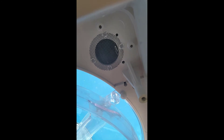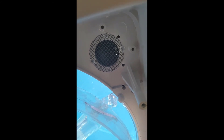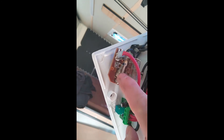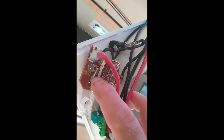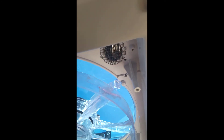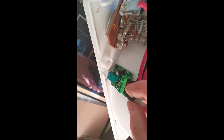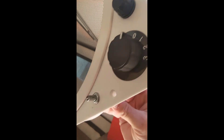I did take the time to cover that so no water gets down in, because I'm assuming that this three-way switch here I will have to put it up on number three the whole time to make everything work. Because I'm assuming when it goes to two and one, that's when it makes heat on the resistor. And when it's on three, there will be no heat, so I won't need the vent. So we leave that on three the whole time and then that's our switch to vary the speed of the fan.